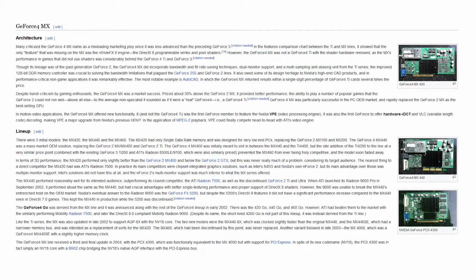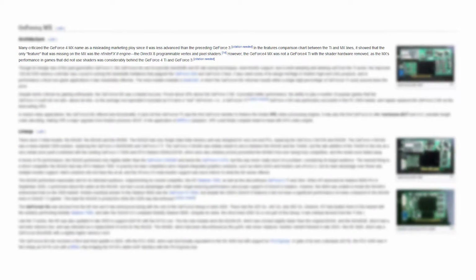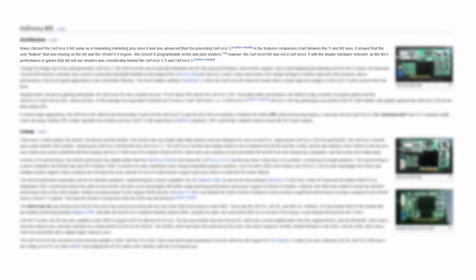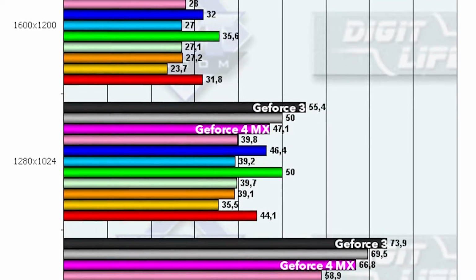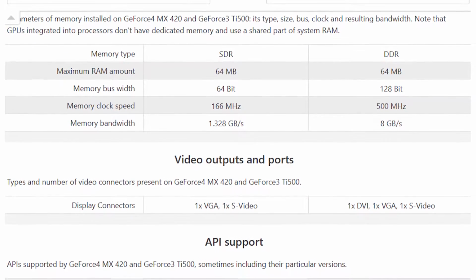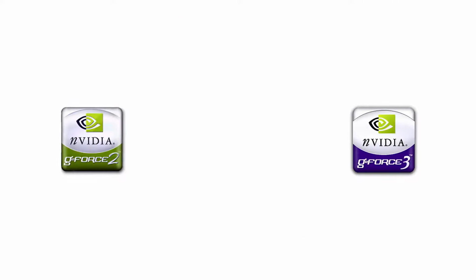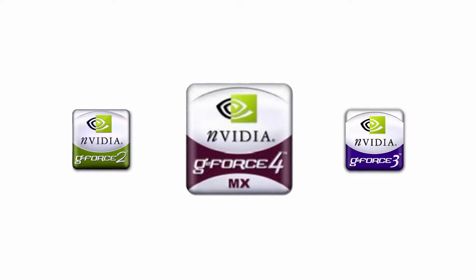Interestingly, at the release of the GeForce 4 MX line, many gaming enthusiasts criticised NVIDIA for making them a part of the GeForce 4 line, considering that the MX line ran worse than the preceding GeForce 3 line of cards, due to missing vertex and pixel shaders, meaning that the MX cards fell as a weird in-between of the GeForce 2 and GeForce 3 line.